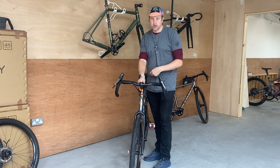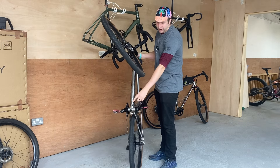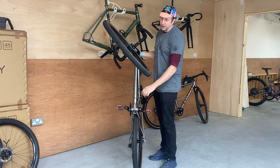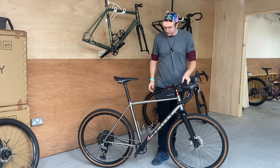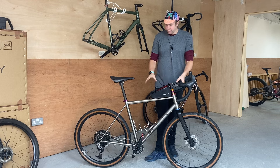I've got the gear cable switching across and down the down tube. The frame did have two bolt holes at the bottom for an extra bottle cage, but they were fouling the gear cable, so I've switched them out with some rubber bungs just so nothing's going to catch the gear cable and make it twang as the customer uses it.